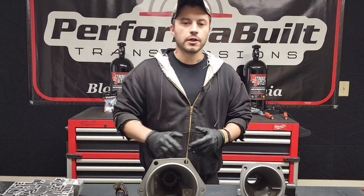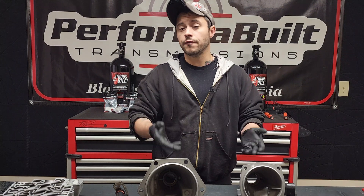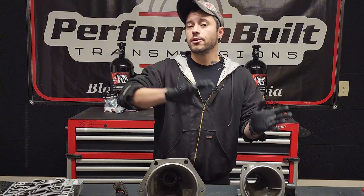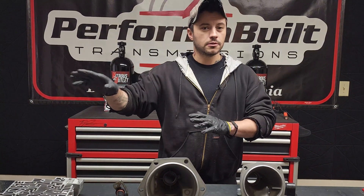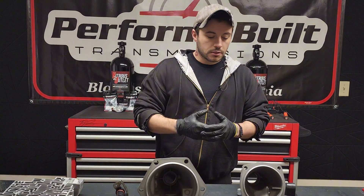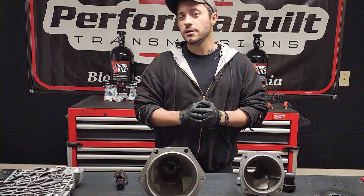The wires and the five-volt signal are still the same, so it's a very easy conversion to do. For four-wheel drive guys, it all depends on your transfer case — you aren't going to worry about any of this stuff; your speed sensor is in your transfer case. I hope that clears up that little tidbit — short, quick, easy, clean.